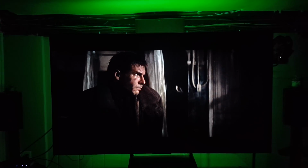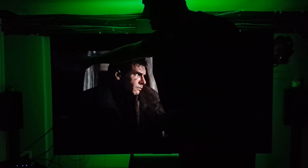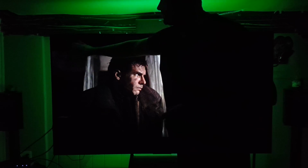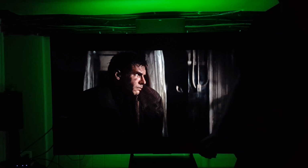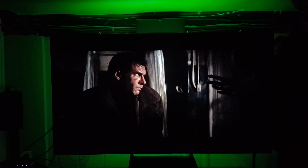We're now on a pretty dark screen, so you really shouldn't see any. Now, if we proceed to a lighter screen, if there's something that's bright right in this area, you may see this color change slightly. That's not really flashlighting, that is blooming. The Sony 900E has more blooming than the 940E and the Z9D, simply because those displays have many more zones. Same with the Vizio P series, a mid-range TV that also has a lot more zones. That's just the nature of full array when you have not as many zones as the others. The zones are well placed on the 900E, but it's not perfect.